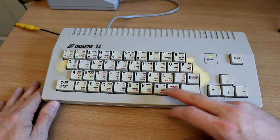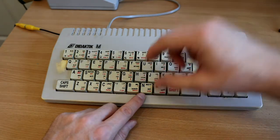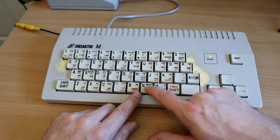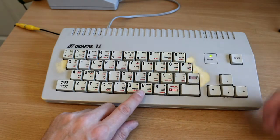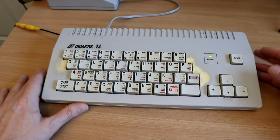And when you're removing the keycaps themselves, if you're using a key puller, don't pull straight up. Put some tension on it and then just rock it side to side, and you'll actually undo the clips at either side one at a time, and the key comes off so much easier that way as well. Other than that, it's a fairly easy thing to work on.